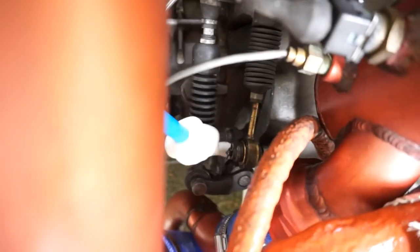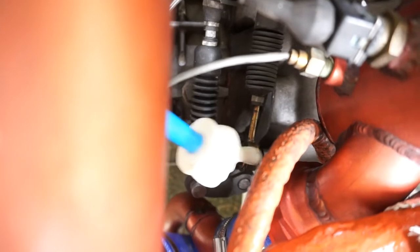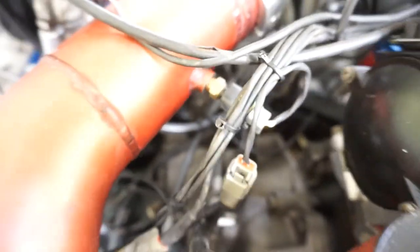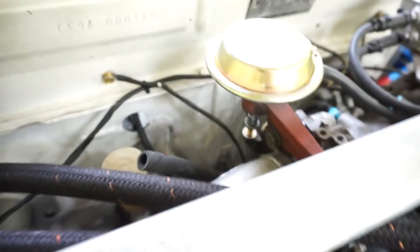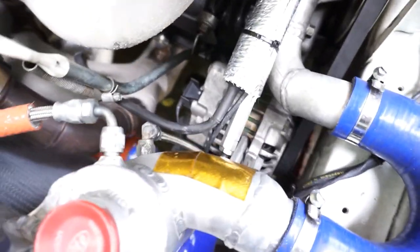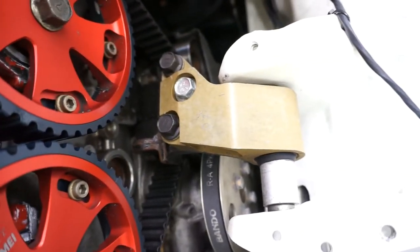Unlike the regular transmission, all these linkages are in double shear instead of just a pin through one bracket. Bosch 1000cc injectors, custom wiring harness with pretty much all Deutsch stuff. Air temp sensors are up there as close as possible. This is the anti-lag kicker — I'm going to go to a different style kicker next time. This is a little reservoir pot for the anti-lag with a one-way valve so you can switch the anti-lag on from inside the car.